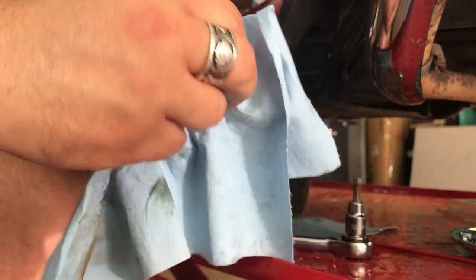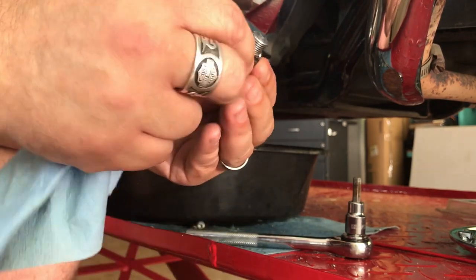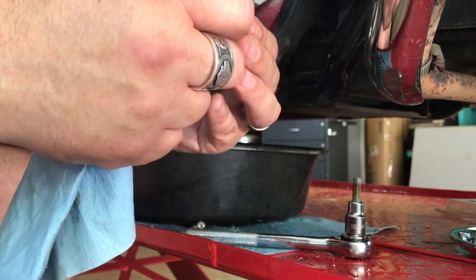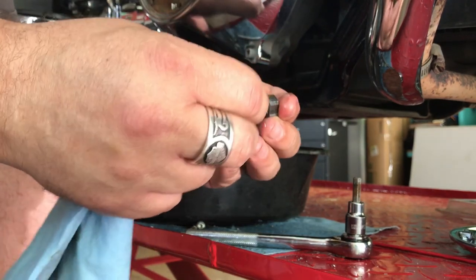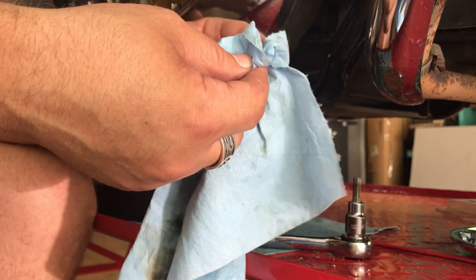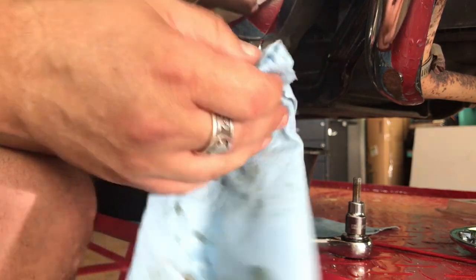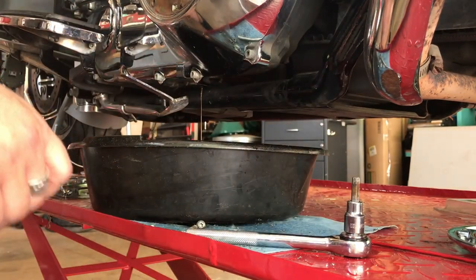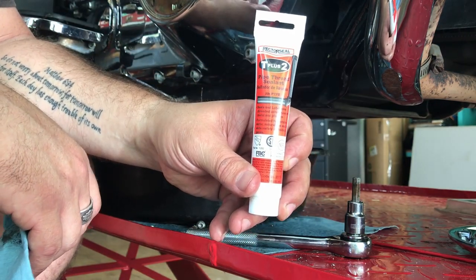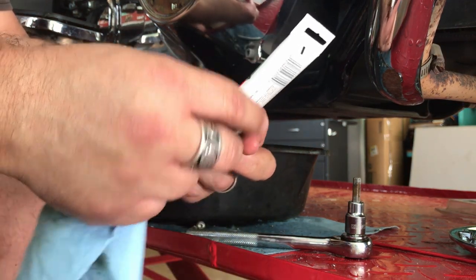With the exception of that one huge chunk of metal, it isn't really too bad — normal for the amount of miles this has on it. You're also going to want to inspect your rubber o-ring at the bottom for any rips and tears. I just look to make sure it's not torn, ripped, or cut, because you want a good seal. This one looks like it's still in fairly good shape. Instead of Teflon tape, we're using pipe and thread sealant — a Teflon product — to get a good seal.